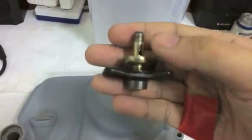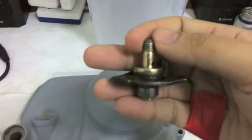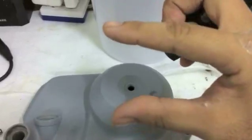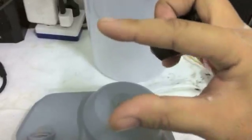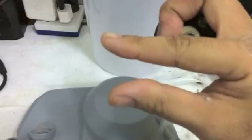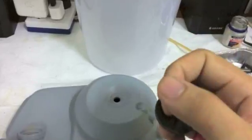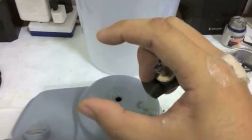How this adjuster works is that as your clutch plates wear and as other parts of the pack wear, the sandwich, so to speak, if you remember from the clutch video earlier, the total thickness of the clutch pack is going to get smaller and smaller because bits and material are coming off. And so it's like when you adjust the brakes on these, the cable brakes, because the material is wearing off